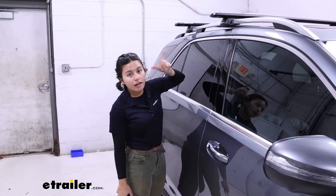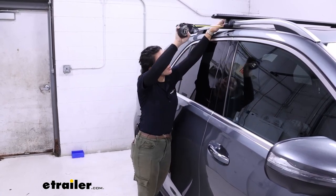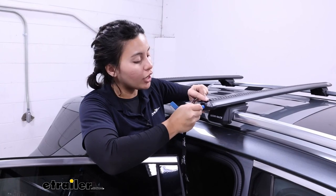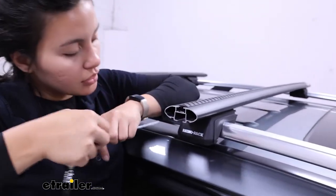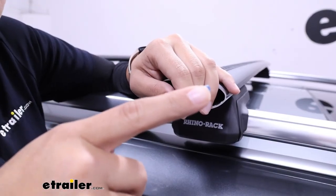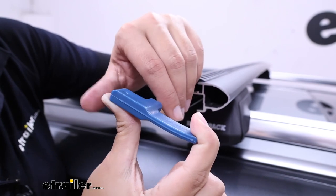Next, figure out your overhang so you have an equal amount of crossbar space on each side. You don't need it perfectly equal, it just looks better and more balanced. Measure from the end of your pushed-in tower to the end of the crossbar — here we have 3.5 inches. If the other side matches, great; if not, adjust until it does. Once you're happy with where you have your crossbars, tighten them down. The bolt is only accessible with the end cap off. You also have your special Rhino Rack security tool, which has a torque setting to prevent over-tightening. Put the weight on your wrench as you tighten — if it straightens out, you have good tension; if it goes past, it's too much; if it doesn't go straight, it's not enough.